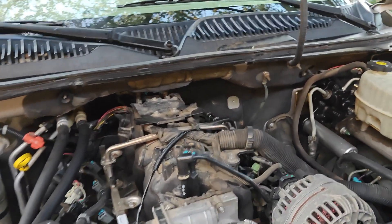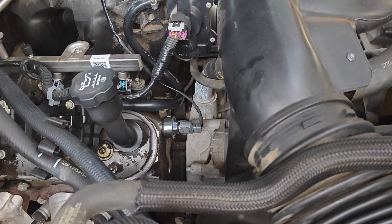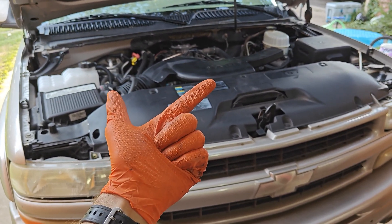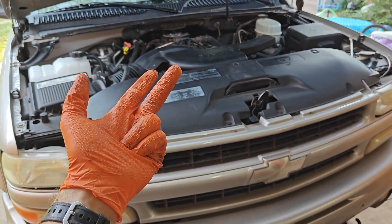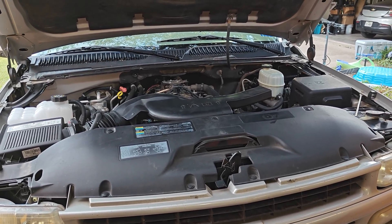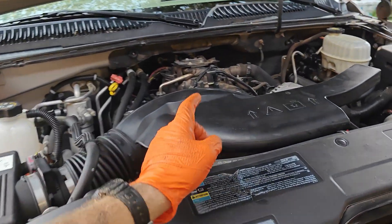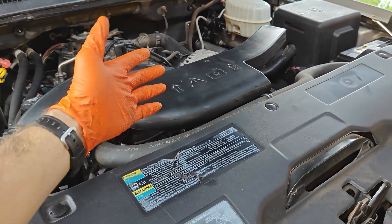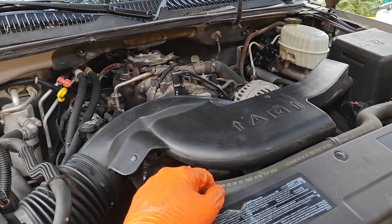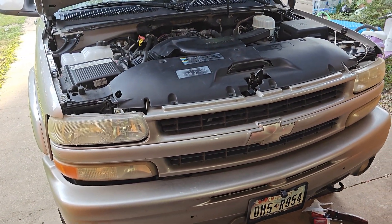That's going to wrap it up for a knock sensor relocation on the Gen 3 LS — it's going to be the same for pretty much every Gen 3. Some hints on sensors: go with NTK, Delphi, or Duralast. Some people might balk at Duralast but those are actually one of the best-rated sensors for these trucks. Delphi is going to be the top of the line, NTK is good also. AC Delco — I've had so many problems with those, I would totally avoid them. Delphi is fine, Duralast has a lifetime warranty and they're easy to get to now. I'll put links to all the parts in the description — if you have any questions, put them in the comments. Thanks for watching.